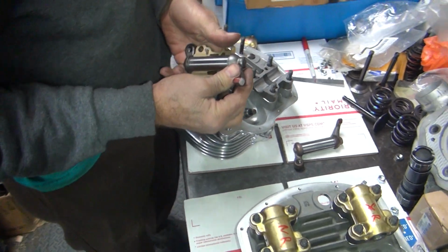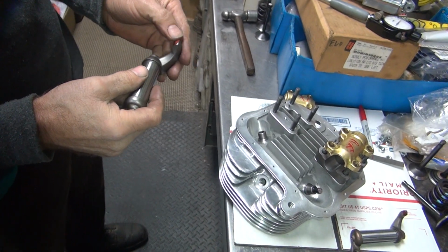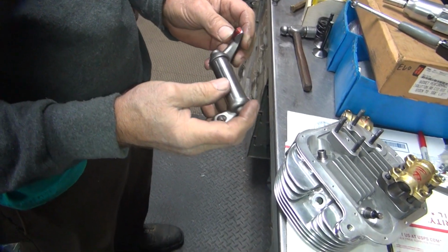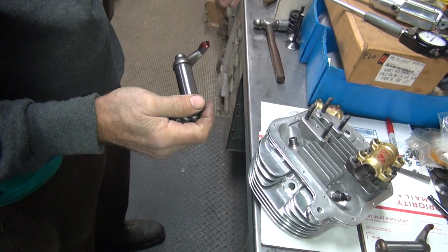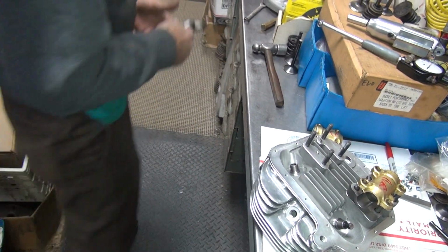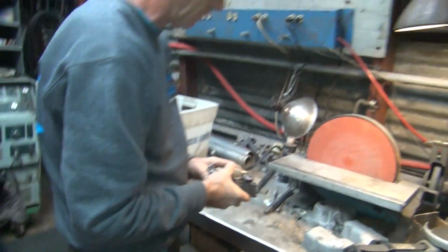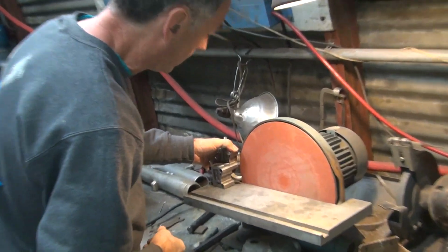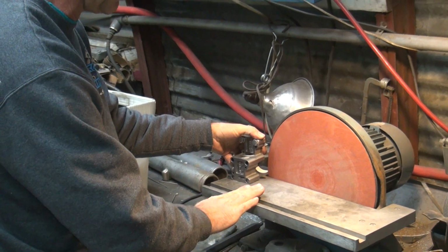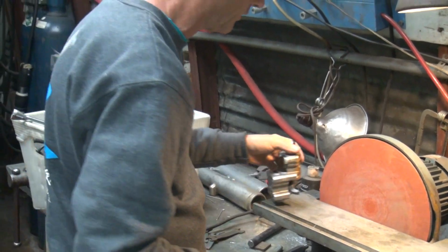Okay, so we need to get this about half of this amount of error, because that's way too much grinding on that one side, which is what I thought it was doing. Luckily, most of that we're not going to use because it's past the top limit. Alright, go grind some more. I'll do that. You wait too long, you're going to miss everything. Okay, so we are grinding too much on the bottom, which means this table's too far down, it needs to go up. About that far.